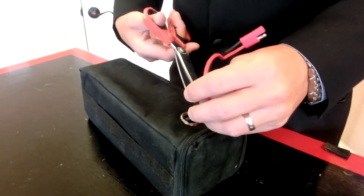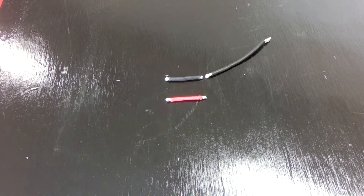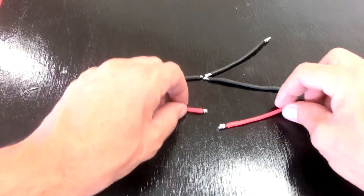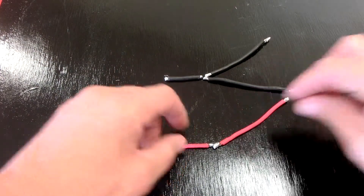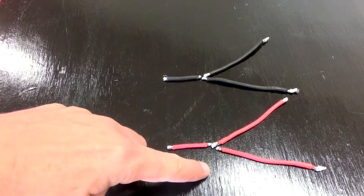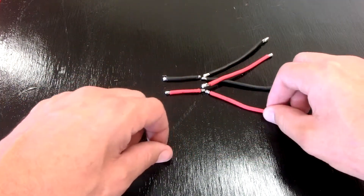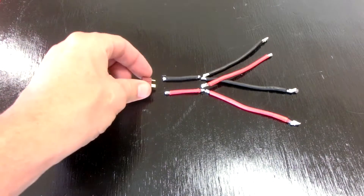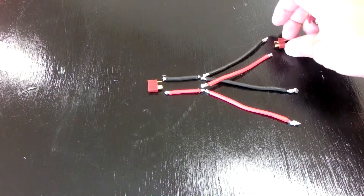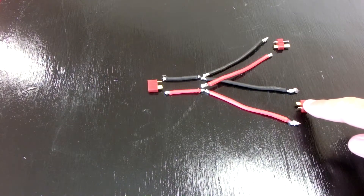Let's lay out our plan to build the parallel cable that will connect the batteries to the scooter. We're going to assemble the black wire and the red wire in two Y shapes, and solder the center points. Once we've soldered and insulated them, we move the two wires next to each other. We're going to solder on the female connector on the left side and two male connectors on the right side — positive to positive and negative to negative.